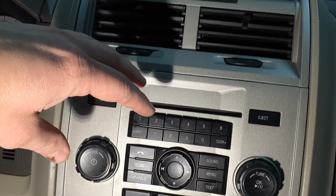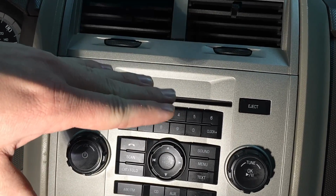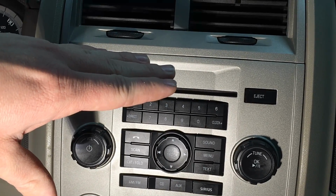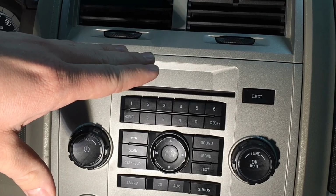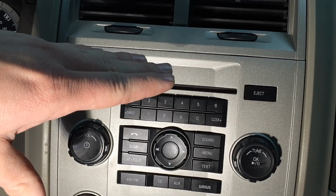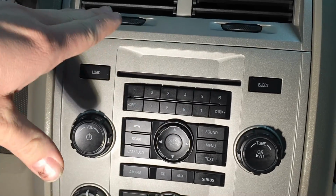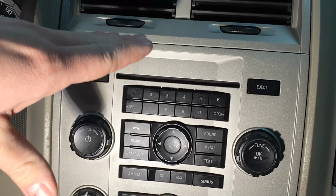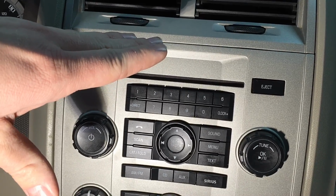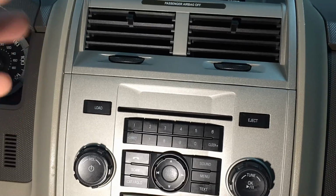Well, on the newer ones, the problem is the wiper arm that moves inside of there to track the position of the door actually goes bad. They get contaminated, corroded, the contacts get worn, so it's constantly going back and forth trying to find the position, because it doesn't want to go to the full tilt endpoints and break the door inside of there. So it's constantly moving around trying to find where it's at. This can cause erratic temperature swings within the vehicle.